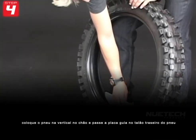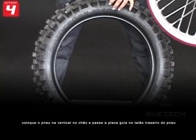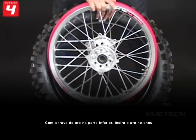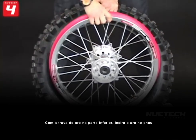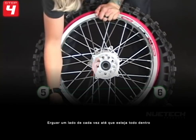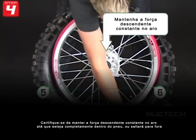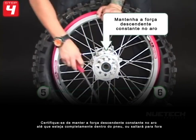Stand the tire upright on the ground and go ahead and hang the guide plate on the back bead of the tire. With the rim lock at the bottom, insert the rim into the tire. Pry one side at a time until it's all the way in. Make sure to keep constant downforce on the rim until it's completely inside of the tire or it'll want to jump right out.